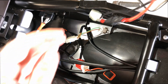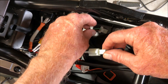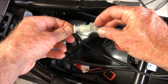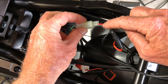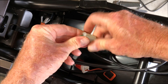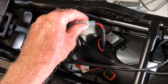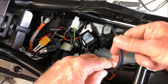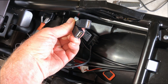We're at the back of the SoCo now in the seat. Here's our converter. This is the connector that we've just put on. Let's put the connector in before we click it in place. Black, which is the negative, goes to green, and red, which is the positive, goes to brown. So we just click it into place — and that's done. Now the connector's in and we have our 12 volts going to our converter through a fuse. This should give us 5 volt USB power. Next thing to do is check and see if it works.